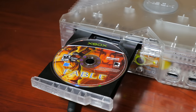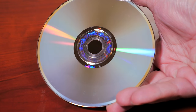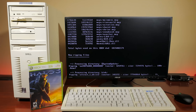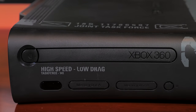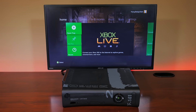The first area that got the attention of hackers was the DVD drive. The original Xbox and Xbox 360 DVDs share many similarities. With the Xbox 360 originally utilizing the XGD2 format, which was designed for the Xbox 360 but based on the original XGD1 format of the Xbox, it was possible to easily rip both Xbox and Xbox 360 discs with a single modified firmware on a PC without too much trouble. Hackers started to take a look at the Xbox 360 DVD drive very closely, and it was theorized that Microsoft may have overlooked it when considering the security on the Xbox 360 as well.